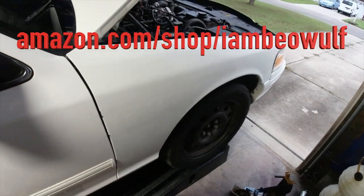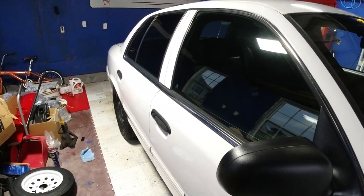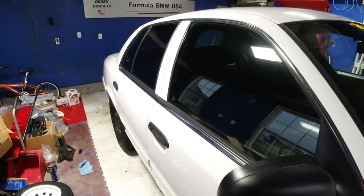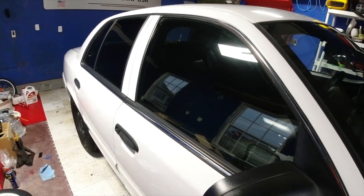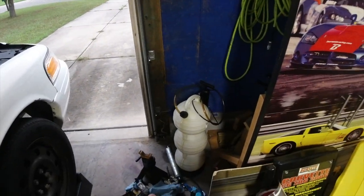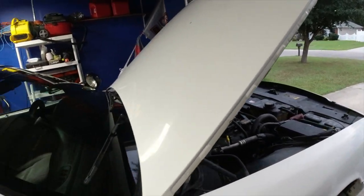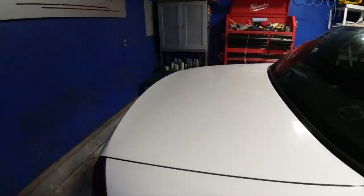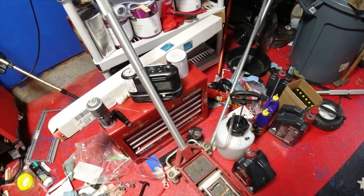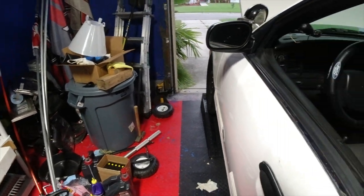They're ready for trucks and they actually work out pretty nice — just roll right in, didn't take the whole hassle of jacking up each side. When I do the differential fluid change, I'll probably just jack up and make it even off of this, because you need it somewhat level to drain it out. I think I'm going to use this pump I used for oil changes on the jet skis to go right to the fill plug and siphon it all out. And I got this filler thing — same one I used when I changed the differential fluid in the transfer case in my Jeep SRT — I'll use that to do that fluid change on the differential.